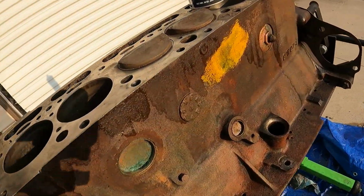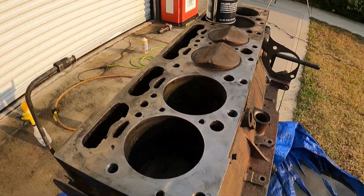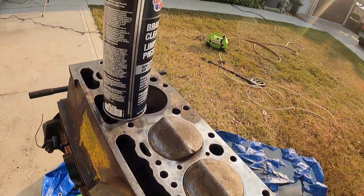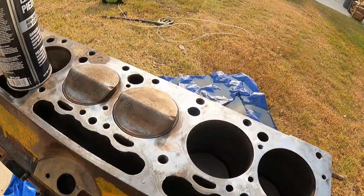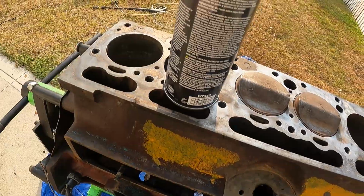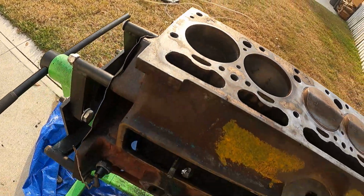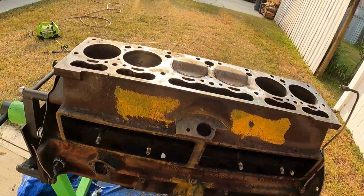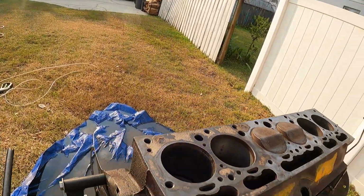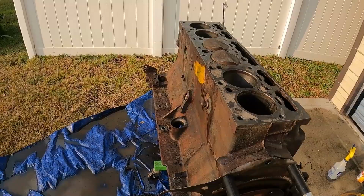And when I get done here, we're gonna move it in and we're gonna start caking stuff down with oil. And when we get ready to put the head on, this area will get cleaned up perfect. There won't be no gasket left. All the gasket surfaces will be cleaned up perfectly for proper sealing. And we're going to chase the head bolts, make sure they're all cleaned out.